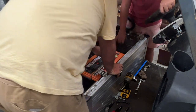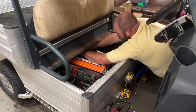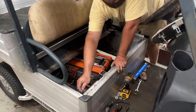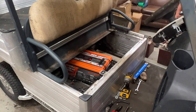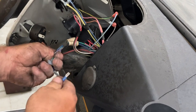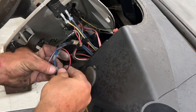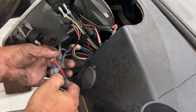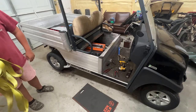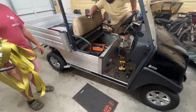I'm going to use this EnjoyBot battery down here — this is not going to be the permanent battery, just to see if it'll work. Let's turn the battery on. We've got a full battery gauge now. I need to adjust the key switch — I can't find the key so I made a little jumper wire with two spade ends to bypass it. There's a purple wire I'm not sure about yet, but we've got the battery in and the switch is bypassed.